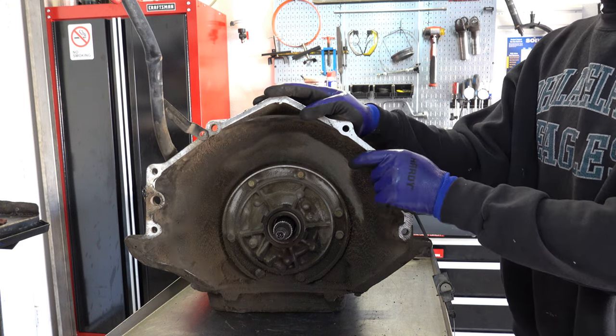There's different sizes of boost valve. The standard size is, I'm not sure exactly how wide it is, but I'll annotate, but there's this size, then there's one size up, and then there's a larger size which you can purchase aftermarket, and that's what I always install when I go back together with these. Here's your reverse boost, your pump pressure regulator spring, and then the PR valve itself.